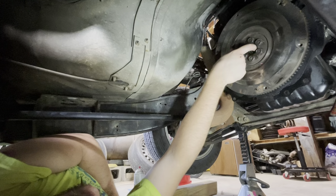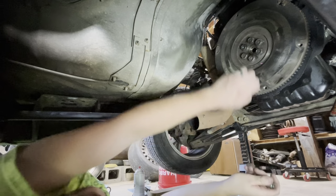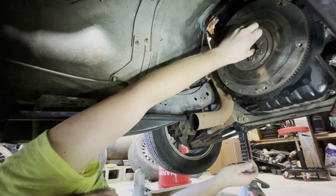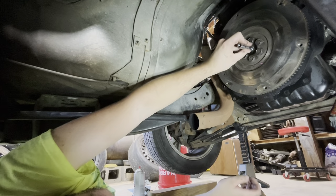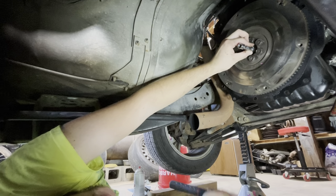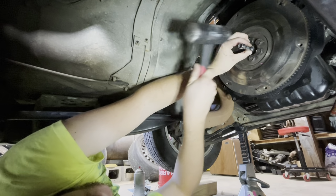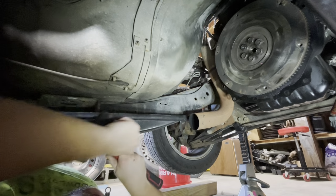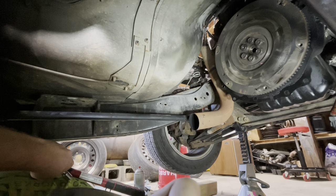When I'm going 60, 65 towards a town and I slow down to a 30, I have a tendency to pop her into neutral and let her coast and brake a little bit. It used to idle all the way down to 500, normal idling. Now it stays up there at 11, until I stop at a stop sign or a traffic light, before it drops down to 500. And then when I get it down to 500, it sounds like it's cammed. It goes brum, brum, brum, and it shakes the whole truck.